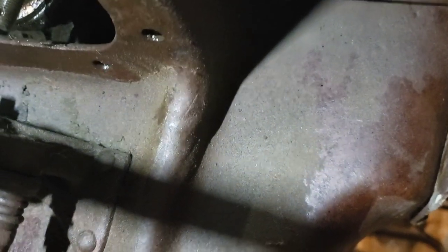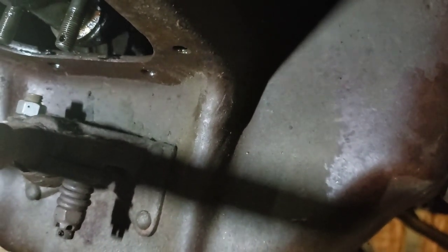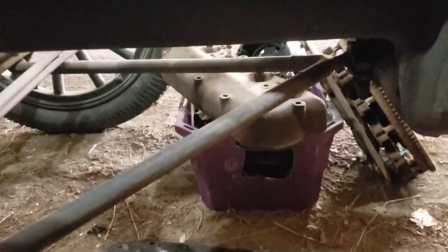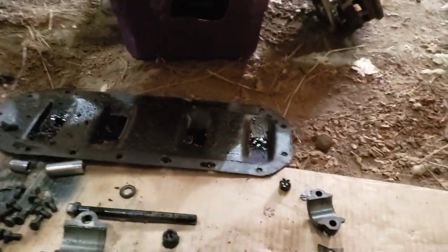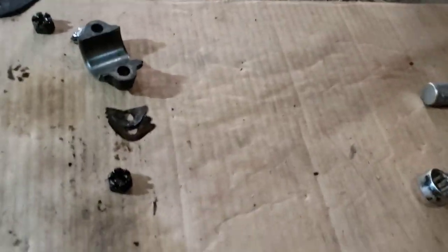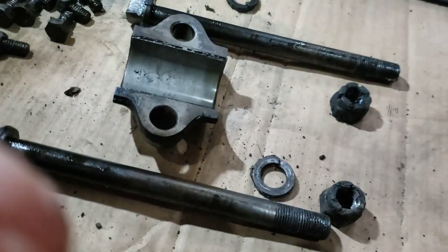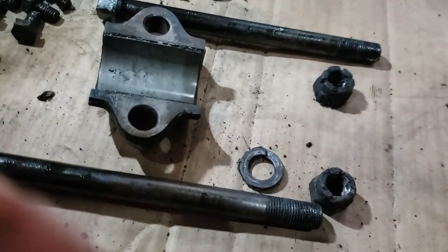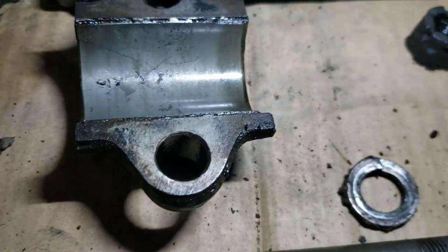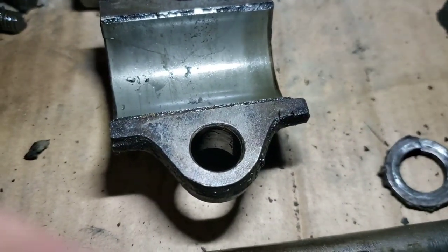I can't get at the rear main without disassembly — the flywheel has to come off to access the rear main bolts. The mains on a Model T use long bolts that clamp right through the casting; the bolts aren't threaded into the block, they go through it with a castellated nut on top. So the mains are clamped rather than just supported by the block. Now here's the center main — no shims in this one either, and you can see the babbitt is coming apart: it's cracking and there are pinholes in it.